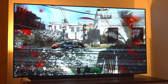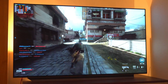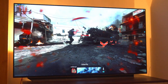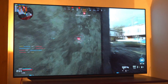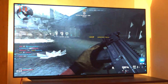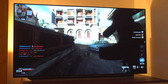My final overclock was plus 186MHz on the core and plus 509MHz on the memory, giving an average FPS of 50.5 — a 4.1 FPS improvement over stock, while also being 10 degrees cooler. As for the brute force mode, no one ever has fans pinned to 100% normally, but you can see how well the cooler distributes air — an extra 20% fan speed over aggressive mode gave a 5°C reduction to 59°C average under full load. This cooler gives you great flexibility, and the best part is getting within 5 FPS of RTX 3090 performance for almost half the cost.